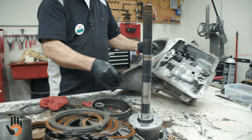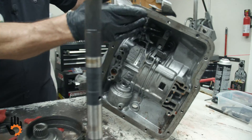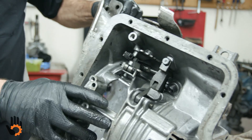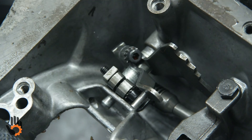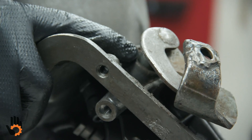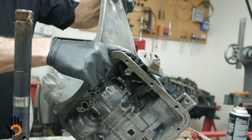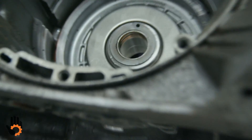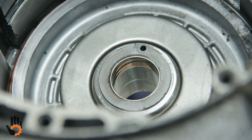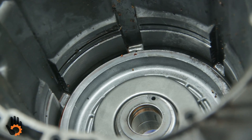As far as the case goes, not a whole lot — we'll be checking threads and so forth. We would have to disassemble this linkage here, which is a little bit complicated on the Powerglide with a couple of different clamps. You need to be able to get this apart, pull the shaft out of the case, and replace the linkage seal in here so we don't have a leakage problem. It's not that tough — pay attention when you take these things apart and you'll be able to get them back together. The case bushing deep down in the bore in the center will get replaced during overhaul. And we need to remove that piston and spring assembly, replace the seals before we wash the case.